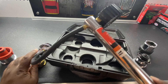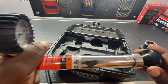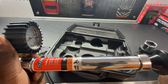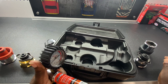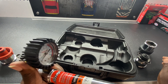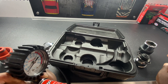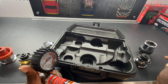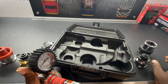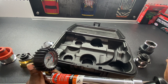If you think you have a leak in the system, it has this pump and you pump up the pressure in the vehicle. Then you leave it for several minutes to check for a leak. If the pressure drops really fast, you have a big leak. If it's a small leak, it'll gradually drop over several minutes. While the pressure is on, you can inspect for coolant coming from any fittings, the water pump, hoses, the expansion tank, or the radiator — pressure forces it out at the weakest point.